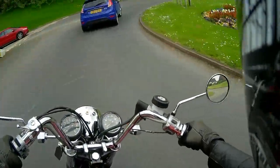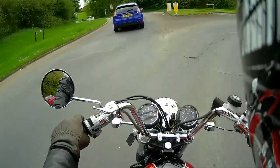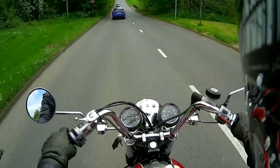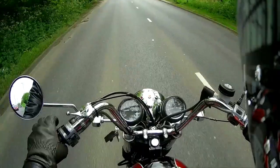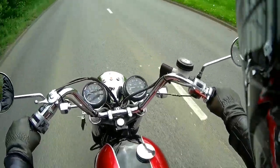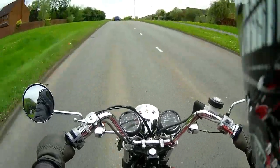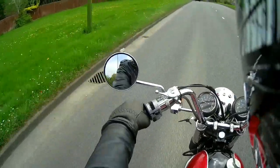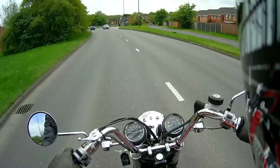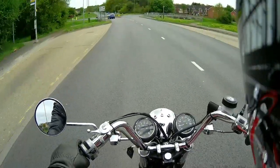When I first got this bike it had a 7 plate conversion in it and the plates were knackered. So rather than spend £100 or so on a new 7 plate setup, I went for the cheaper £30 option for the original 6 plates. Riding it with the standard setup, it got to the point where I didn't really want to ride it anymore because the clutch was so heavy.